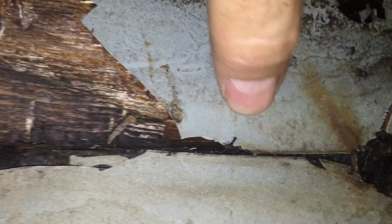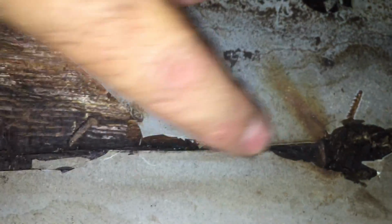For people climbing in and out of the compartment probably. So wherever there was no fiberglass reinforcing, there's hairline cracks. There were several of these cracks where this paint separates here, these two sections of paint. Here, there was no glass. So you have a crack right across here. This crack was in many places. You can see some other hairline cracks. So wherever the mat stopped, and there was only resin, very little fiber, and then epoxy, it got hairline cracks.